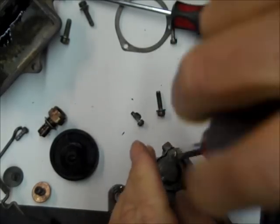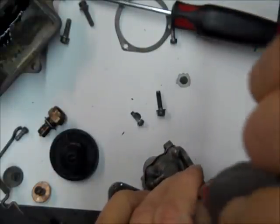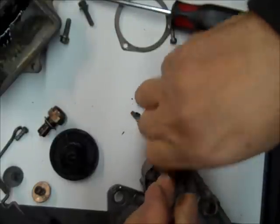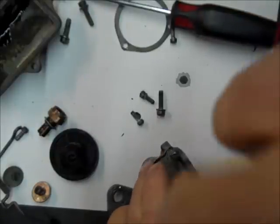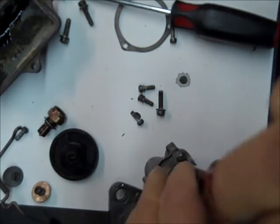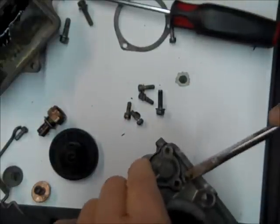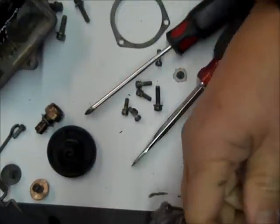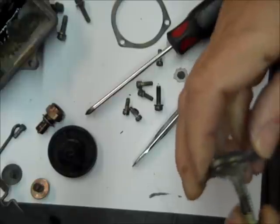It's your Economizer diaphragm. There's 3 screws, goes in the top. You can sure smell the varnish in this carburetor. When a vehicle sits around for several months, you can almost count on it getting varnished up, and it won't run right. And of course, at this point, whatever this came off of, well, look how sticky that was.